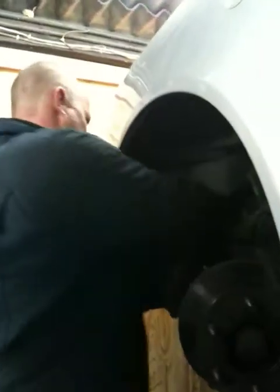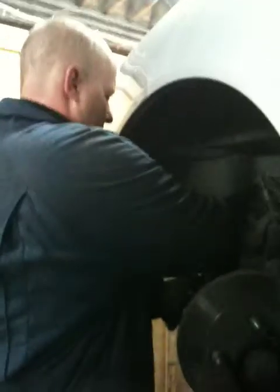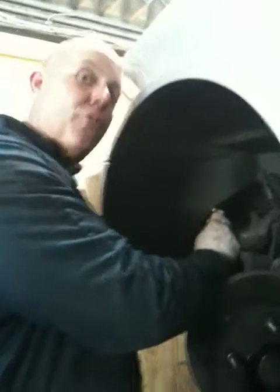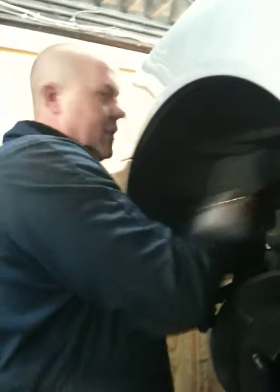Now, no washer. Locate your hole so you know roughly where your split pin's going. Otherwise, trying to turn the nut and locate the split pin hole is a pain in the arse. Right, get it hand tight. Pick up the right spanner, which is a 22mm. 22mm. Not a 23, and a 21 won't fit. A 22. Put it on so it's roughly around about there.